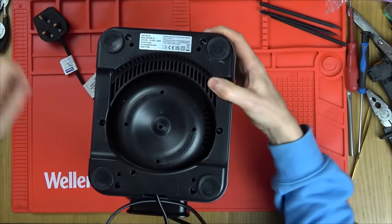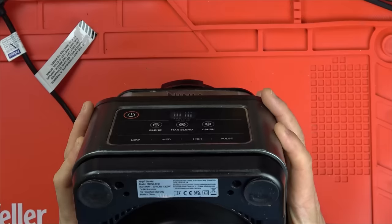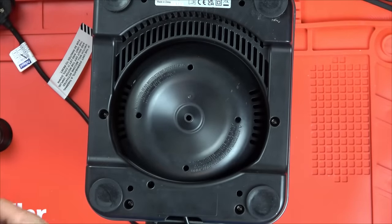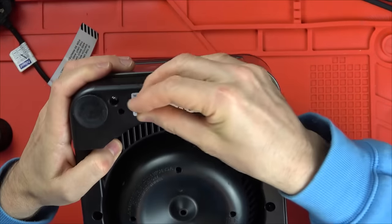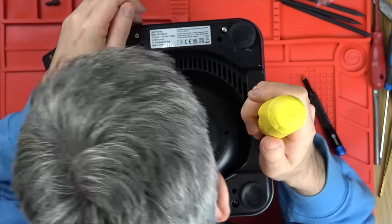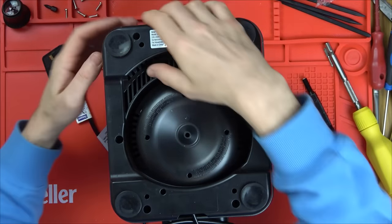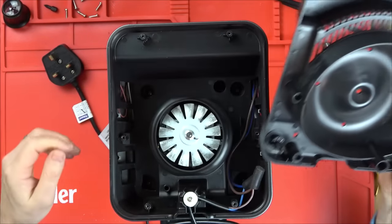This one here is model number BN750 UK 30. Let's take it apart and see if it becomes clear what's happening. We have various different screws at the bottom here and they look like Torx - security bit as well. Looks like they're Torx 10 and they need a little hole in them to get past the little security bit. Obviously I am unplugged when I'm doing this.